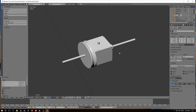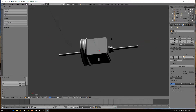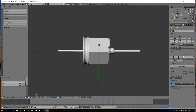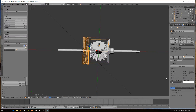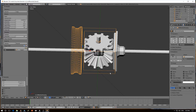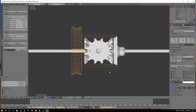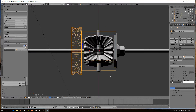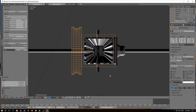This is the differential. It works like a pretty basic one. It's got a pulley that turns the whole body, and if we look inside you can see there's four gears. They all turn in unison, locked, when the car is going straight. The middle ones will spin freely, allowing one wheel to turn faster than the other if the car is turning.